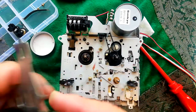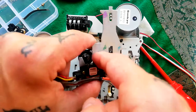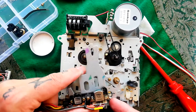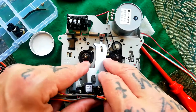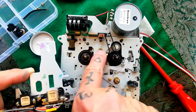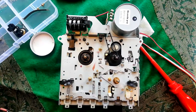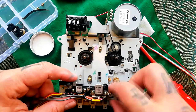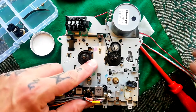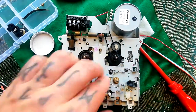A couple of things to notice when you're replacing this plate: I've got the bearings back in their spaces with fresh grease on them. This cassette pin goes through that hole I'm pointing at. This plastic latch needs to go through the plate, and this pin is going to go through that slot. Depending on how raised that is, this protrusion on the plate is going to lift this idler away from the rail table. This part here also needs to go under there, so slide that under, get all the pins lined up, and then use maybe your fingernail or a pair of tweezers to move that lever out of the way until it's sitting okay.